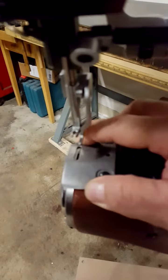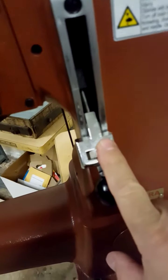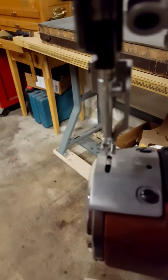What you want to do is have it all loose — see, this one can move around. What you do here is adjust the stitch length to the longest position. Then very gently, once it's in place, cycle the machine so that the needle just starts to pierce.